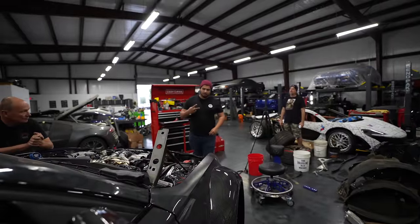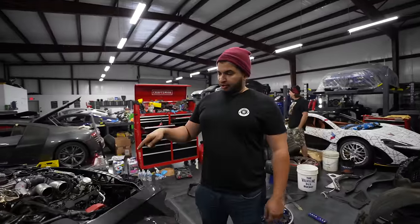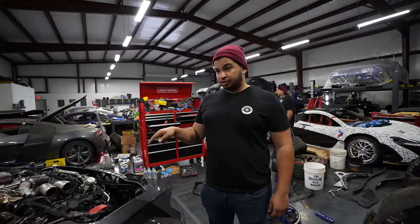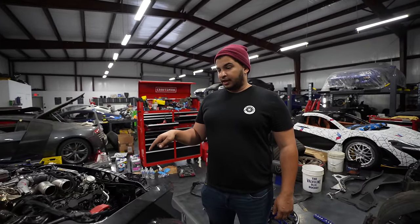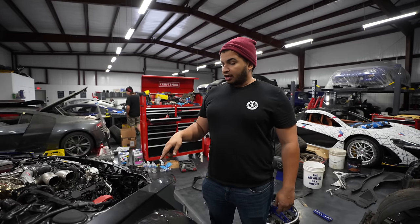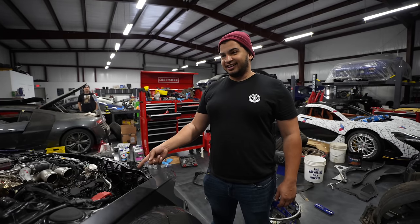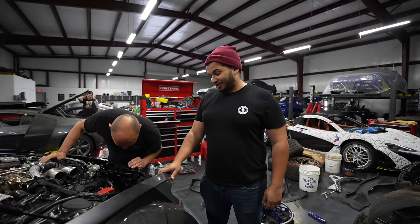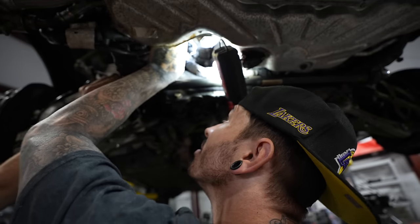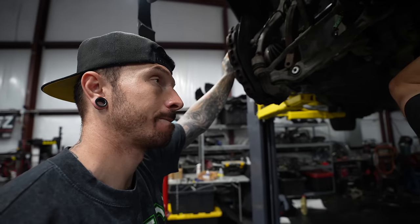Two things we can do. One is we can try to get a wire in here and then measure that you're actually getting voltage, where you should be getting voltage. And if you're not, then that means that it's maybe a fuse somewhere or whatever. And the second part is we'd have to take the engine out. I'm a little bit joking, but like 90% not joking, because it might be that. I double checked to make sure that all the connections were on the starter motor. What's happened?